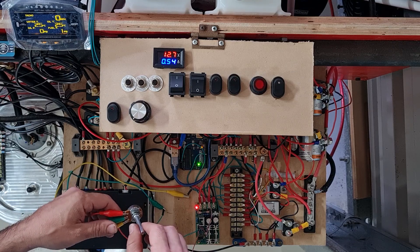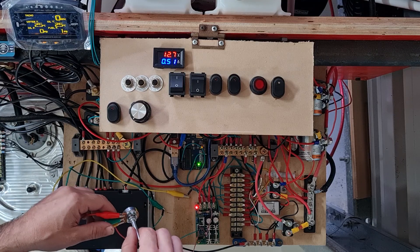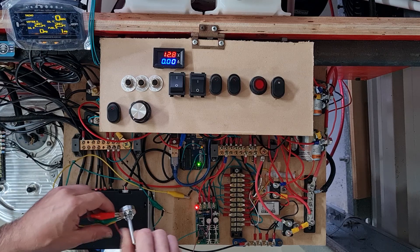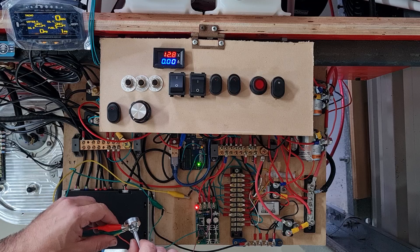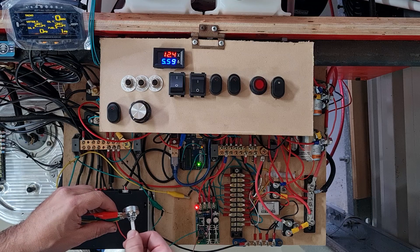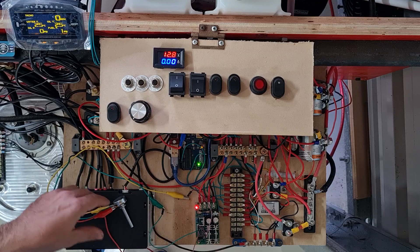The benefit of this is it'll allow me to use the temperature sender on the radiator to govern the speed of the fans. The hotter the coolant gets, the more the fan comes on. I didn't want the fans just kicking on and off with a relay switch, since that would do a big amount of current draw in one hit — on then off, on off. This way it slowly comes on, and if it does get as hot as it does, it just maxes out. Hopefully I can get a steady gradient so when the temperature goes up, the fan speed goes up at the same rate.